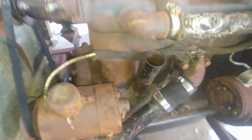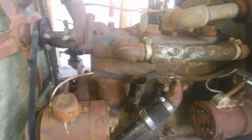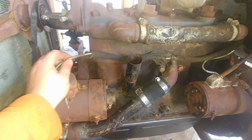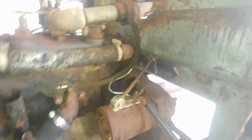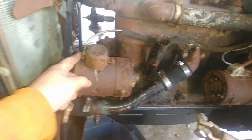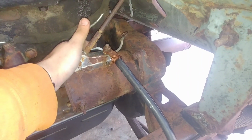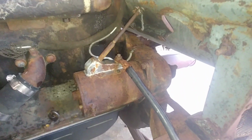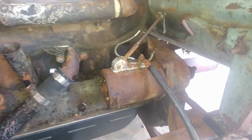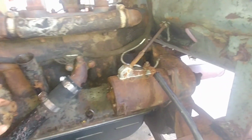So he brought me original, because when you restore something, you should always use brand new wiring, and this old stuff's old. But he brought me an original wiring harness, which had a couple bad ends we replaced, and there's a little spot the insulation was nicked here, so I put some electrical tape over it. But it's better than having no wiring harness. I could make a new one, but it's kind of cool to have actual Model A wiring on it.